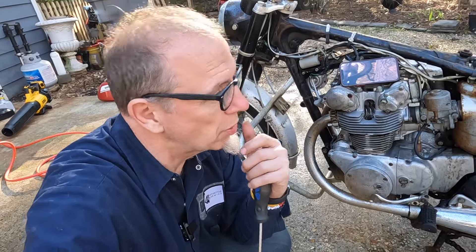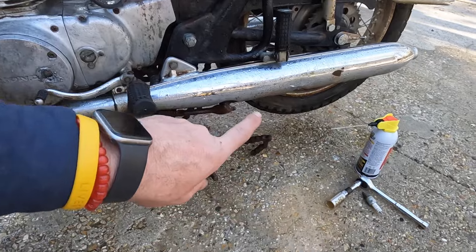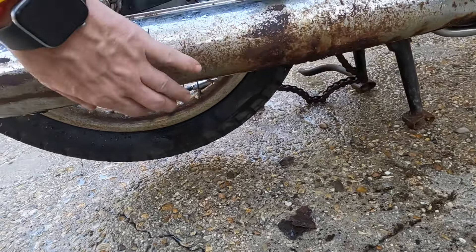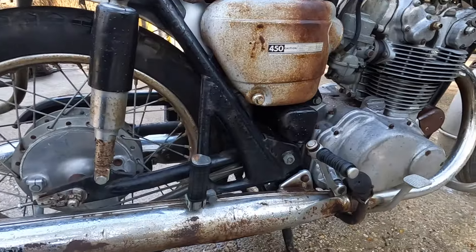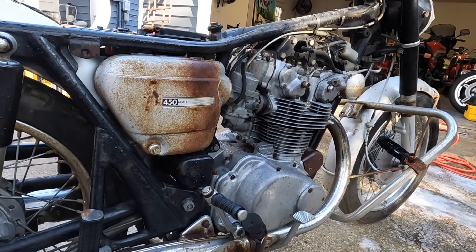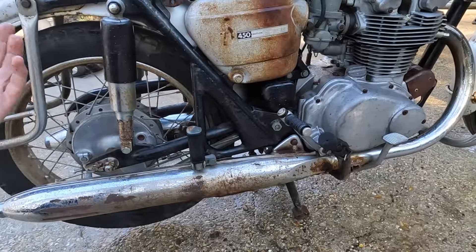That probably came from this thing maybe laying on its side with water coming up through the exhaust. This exhaust on one side is in good shape; the other, not so much — it has some weight reduction you can see, and these exhausts are expensive. My fingers disappear into the rusted-out one. Let's see if this spark plug wants to come off and look at what that looks like. I don't think we can make it worse. The engine has to come completely apart.